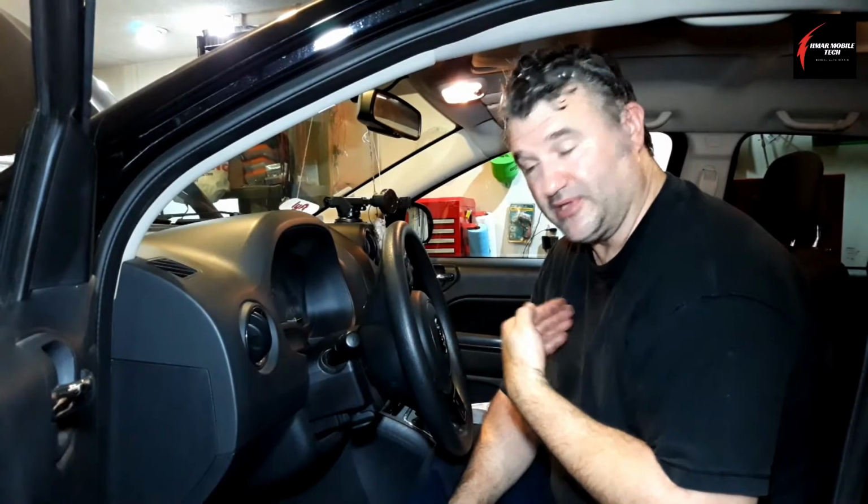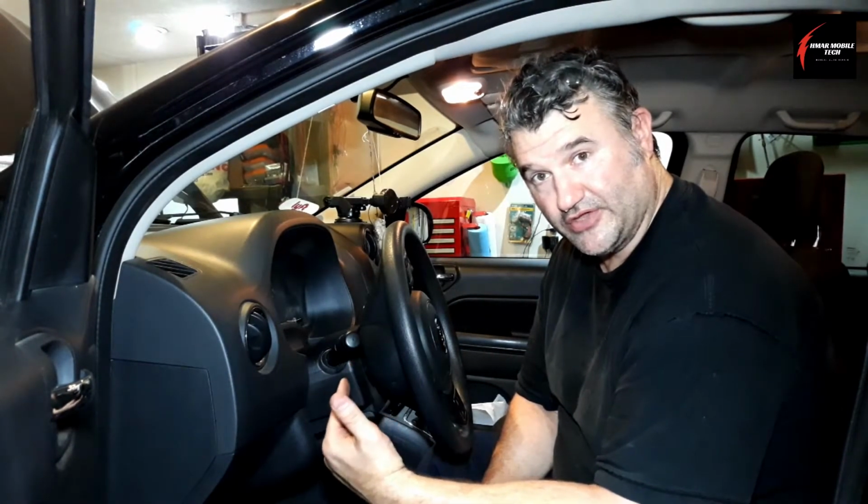The second method, if you don't have a vacuum brake bleeder canister tool that I have, you can bleed it with a helper, and just make sure you know who's going to be designated bleeding and who's going to be pumping. So once you guys figure that out, what you need to do is make sure that the brake fluid master cylinder reservoir is full. And then, if I'm the person pumping the pedal, make sure that the bleeder person, your helper, knows what you're doing so that you can communicate properly.